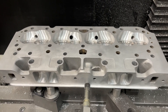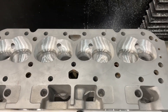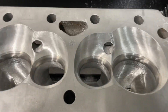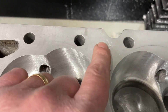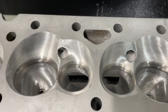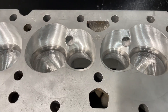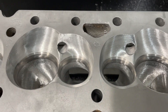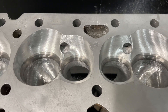However, this video is not about that. They've been bead blasted and they're sitting up here on the mill, fixing to be milled down. But I want to talk about these spots here — you can see them here and here. What this is is oxidation or corrosion. Most people with aluminum heads kind of forget that even though aluminum can't rust, it can oxidize.